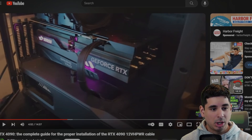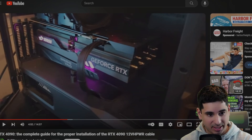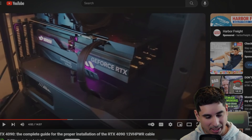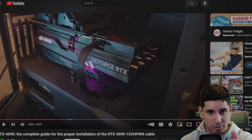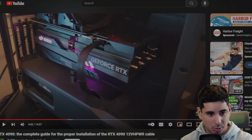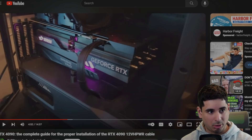When you install any of these cables in your 4090, you want to make sure they are flush with the GPU — there cannot be any gaps. As I say in my install guides, you might even want to tug on it just a tiny bit to make sure it's not going anywhere. If there are no gaps, then it's probably made a proper connection, especially if you have a newer revision 4090 where the pins in the GPU are a little bit longer, which helps with any issues.